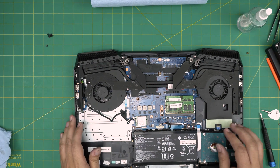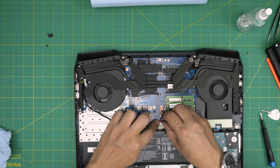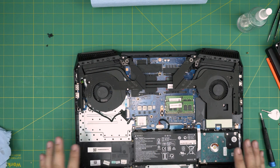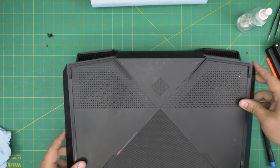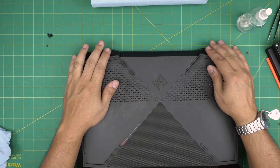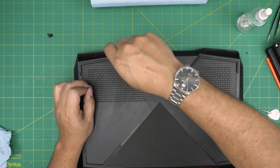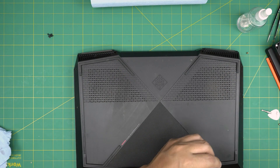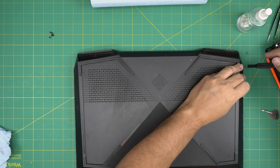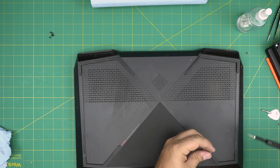Once done, everything is set and ready. The laptop is clean, fan is connected. Grab the battery connector and push it in evenly — not sideways — and squeeze it into the connector. Then take the cleaned bottom cover, align it straight on top, and squeeze down starting at the corners. Make sure you hear those nice click sounds all around the back. Put the rest of the screws in and tighten them. I hope this video helped you service your HP Omen 17 — leave any questions or requests in the comments. Thanks for watching, see you next time!